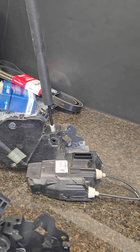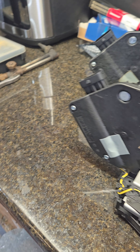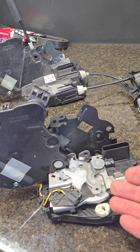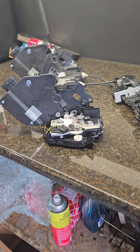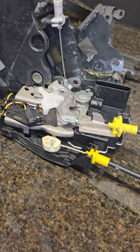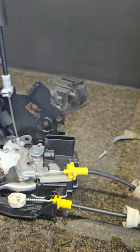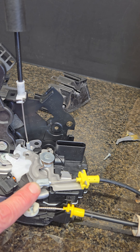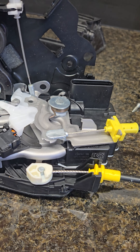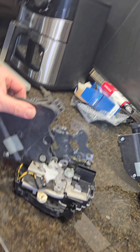And there you go, on the bench. As you can see, this is not covered. I'm going to take all this apart, move all this over into the new one, cover it back up, and then put the whole thing back in the door. Covers off. Just move the linkage over. Put the three out for that one. Put the long one on — don't put it on the big hole, put it on the little hole. This one you have to turn it about 90 degrees and it comes out. This one's pretty self-explanatory. Ready to go back in the vehicle. Covers up.